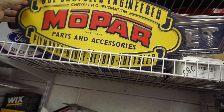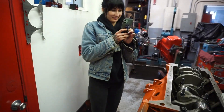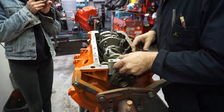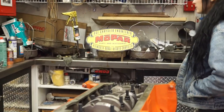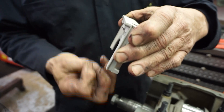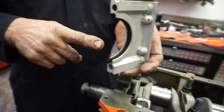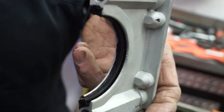God, you're messing up, Mike. Way to go. I think you've already messed up, so you're probably all right. That's a little better. I had to groove. So what happens: the oil pressure hits this and expands that seal out so it fits tight against the shaft so it doesn't leak. You make mistakes putting it on like that — it's like a funnel to the outside.